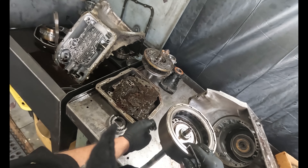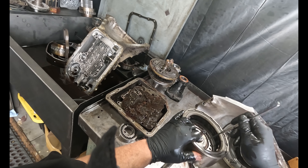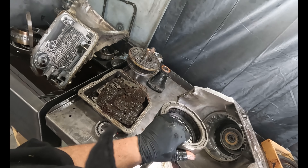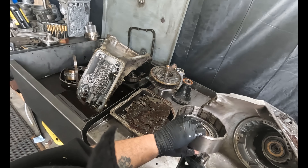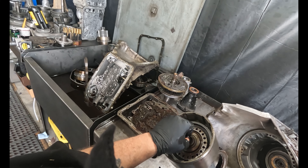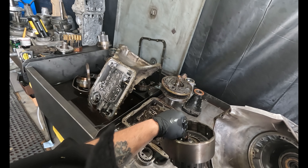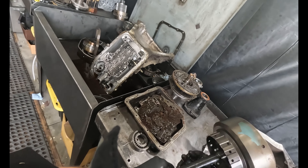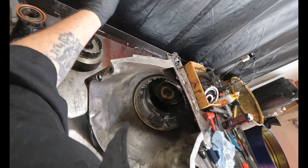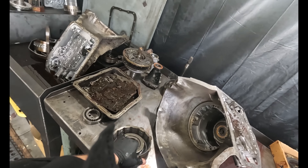Let's take this forward drum out. Okay, you can use this drum because his is all messed up right here. So we got a good drum out of it at least. I have to press the shaft out — that input shaft is finished. It rides into that bushing. Swap his shaft over — the drum is good. This other drum is finished.